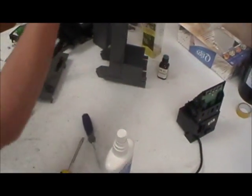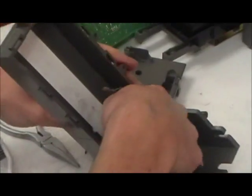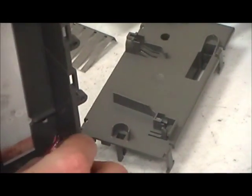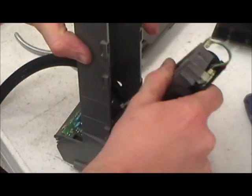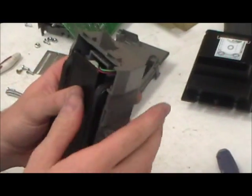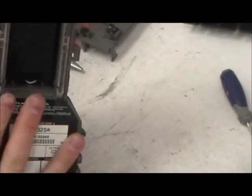Now put the unit back together. Take your stacker assembly first and run the wires back through the hole in the housing. Slide it in to the bottom first and pop it back into the holes. Pull the grounding wire through, feed it back up so there's not a bunch of slack, then push it all the way up. You'll see two holes up there — pop it back into those and into place. Put the intermediate frame assembly back on, then put the lower board assembly in. Plug the harnesses back into the board.